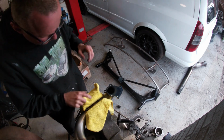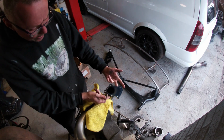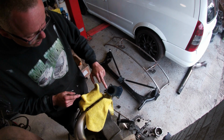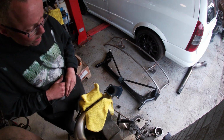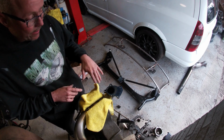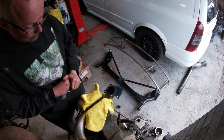I don't know if you can see that, but what it's showing is silver all the way around, which is where the pipe sat and the weld is, which has caused this to pull downwards and become a high spot. So that's just to demonstrate that when you're welding parts, always clamp them and always try to reduce pulling. Anything that can prevent this, do, because it is going to pull no matter what you do, but the more prevention, the better.